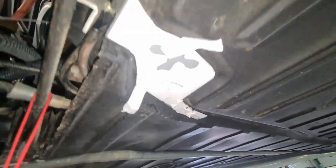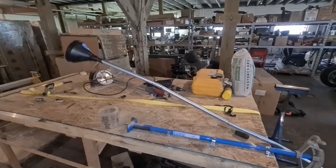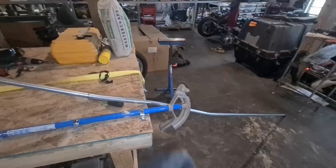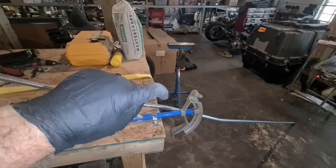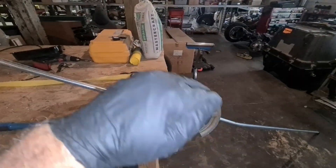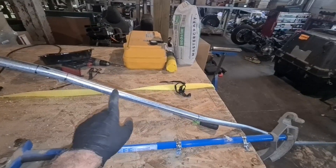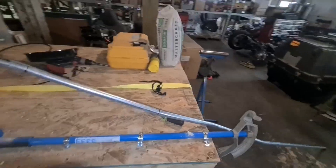For complex shapes, cut out a piece of cardboard and use it as a template. If you have to make a sharp bend in a small pipe like this three-quarter inch and you try to do it cold, you will get kinks — the inside of the curve will ripple. Sometimes that's not a problem, like with water, but I'm putting a 17 mm electric cable through here and I can't afford any extra interference.